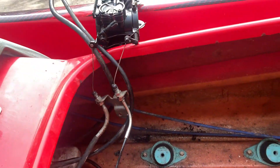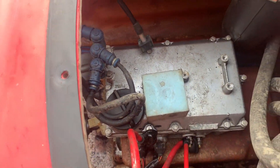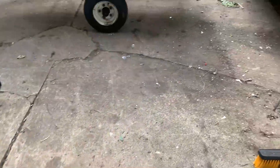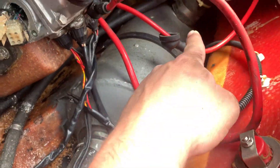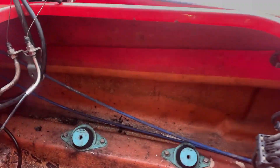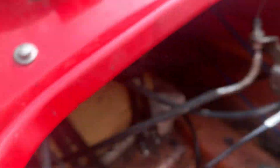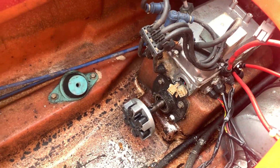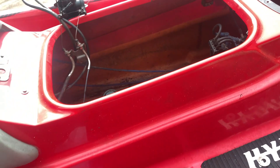Got the seat off. These are the old carbs — they're still bolted up. I kept them there just so I knew which way things went. This CDI box, which they also call an E-box, I'm gonna pull out. I got another one right here in this box. Then I gotta pull out the wiring harness — one plug runs all the way back down to the speedometer, and another one runs up underneath the hood.